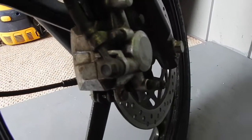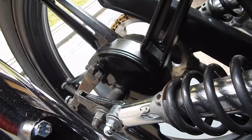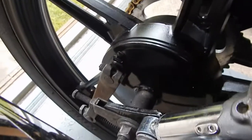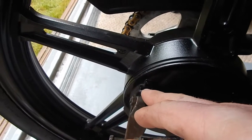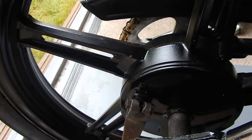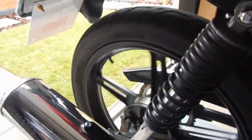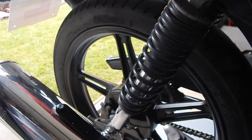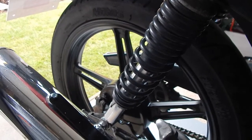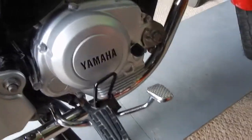General maintenance of this area: no leaks, no excessive corrosion, no free play, and no cracks. For the rear brake on this bike, it's a drum, so there's not a lot to see without taking the wheel out. There's always a good indicator though — on the back of the arm there's a little tin arrow pointing towards a mark on the drum. If it's getting close to that mark, your rear shoe linings are nearing replacement. Also check for excessive pedal travel and, by spinning the wheel and applying the brake, ensure it engages properly without delay, juddering, or nasty noises.